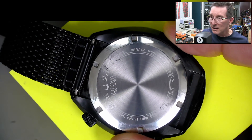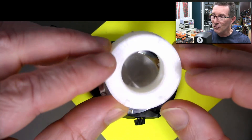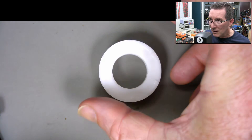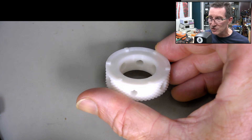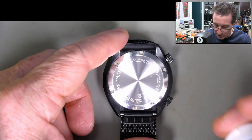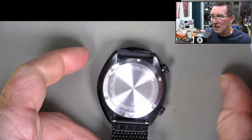It's not easy to open because it has these six little slots around the outside. So what I did is, with my new 3D printer, I 3D printed a little tool that has a knurled outside, so grippy. It's got some holes you can use as a pry bar kind of thing. I did have to print it about 110% bigger because it was designed for a smaller watch. There are other methods — you can get a pair of pliers in there, or use a rubber mat or rubber ball with good grip, push down and twist. That'll often get it off.